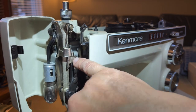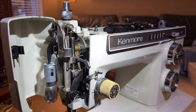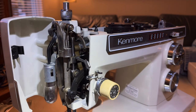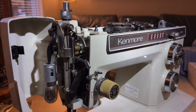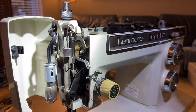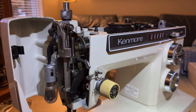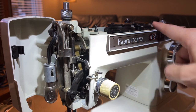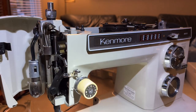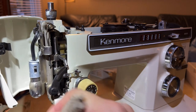These machines were designed for maintenance. Once you've got the maintenance going, you're good for a while - it's not like you're going to be doing this every week or with every sewing project. You basically need some basic oiling when you're getting ready to sew. This pivot point up top is where this whole assembly - what your needle bar is attached to - you can see the bracket. It's almost like a pendulum, pivoting up here, so of course we want to make sure it's able to do its thing. If you do this, you should get most of these places done the first time.